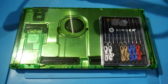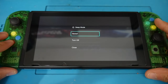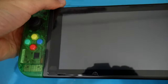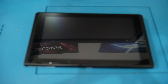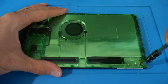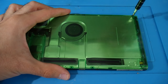Now that we have everything ready, let's get into the console. With the Switch in front of us, first turn it off — hold down the power button and shut it down completely. Disconnect the Joy-Cons, remove any game cards, micro SD cards, and disconnect any cables. All we need is the tablet. Flip it upside down on a flat surface and let's tear into it, starting with the tri-wing screws — one in each corner, four total. Righty-tighty, lefty-loosey.